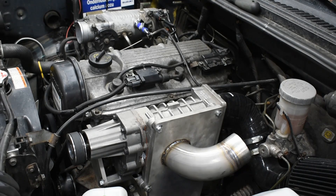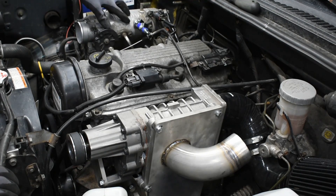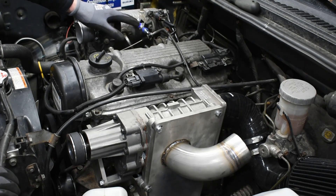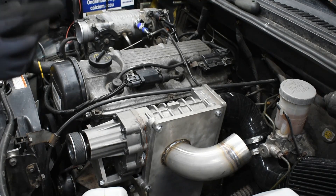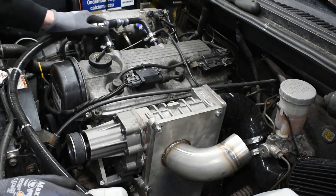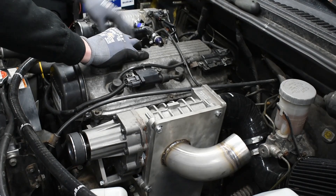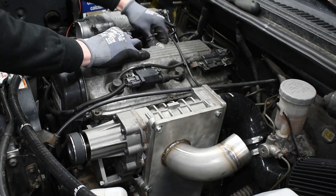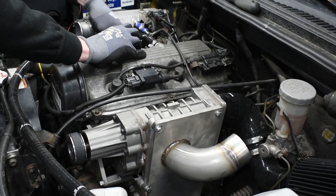After mounting the air filter, we'll have to replace some hoses. Normally there's a hose going from your crankcase ventilation back to the intake. We'll put a little adapter on it so the crankcase breather is just going to go to a separate air filter. Slide it on here, and the one-way valve on the other port is just the original one — stick it in through the rubber and tighten it down with the hose clamps.